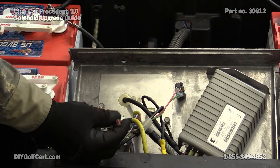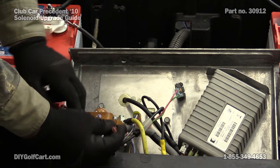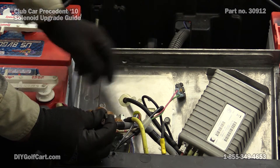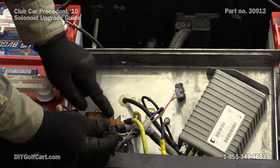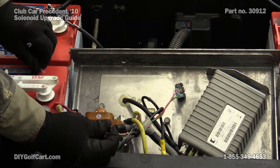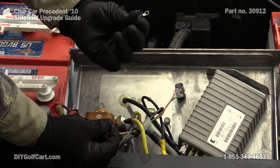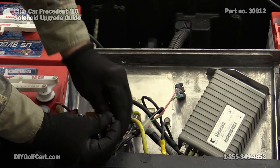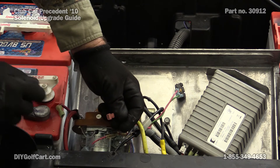As you can tell, the two small wires that hooked up with the activation wires on the old solenoid were female terminals. This new solenoid will need an eyelet — just like this with a little blue end and a small hole that will fit just over that stud. First, we've got to cut these ends off and mount that.